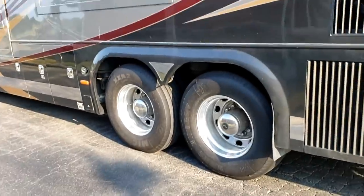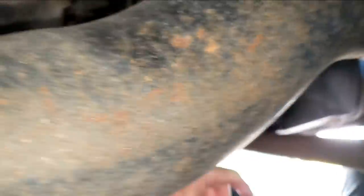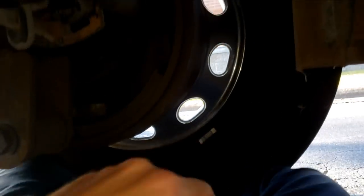You can definitely see that side's way up too high. So I'm underneath the axle — that's a tag axle. The suspension can't go lower than the axle because the axle is what's actually on the ground, so I can't get crushed at this point. The right height control valve — there's one of them.